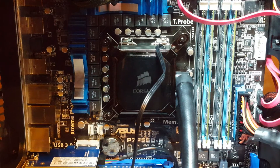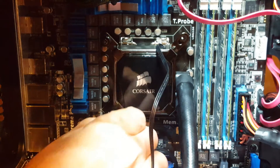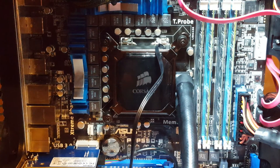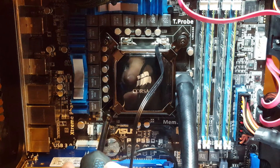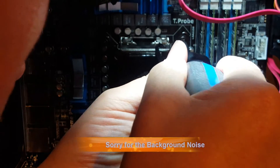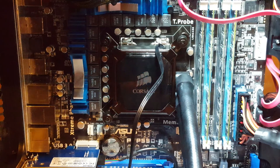There's a bit of noise in the background, I apologize for that. So basically I did the standoff screws — once I had the bracket on I put it in there and everything seemed to go okay. I mounted it on the corner and the corner down there, and now I'm going to do the other two. One thing I'm going to do is just snug it down like I would a standoff on a motherboard — just make sure it's snug, certainly not over-tightened because I don't know what that might do to the CPU, but also not so loose that it potentially comes off.